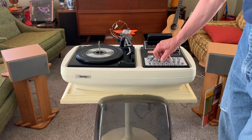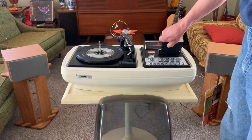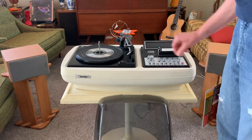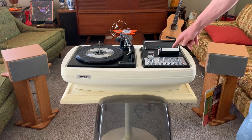I've cleaned all the moving parts in the 8-track player. It did have a good belt in it — it had been replaced at one point because I could see residue from an old belt. Cleaned that up a little bit off the motor pulley. Cleaned all the track lights.